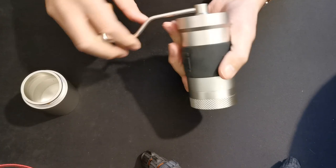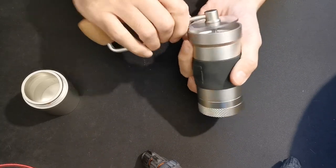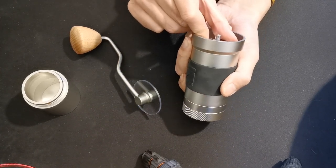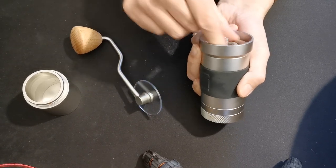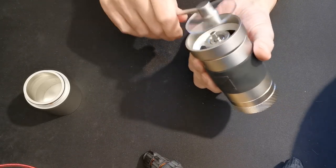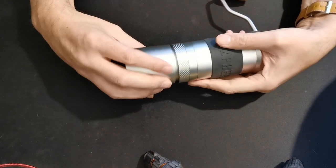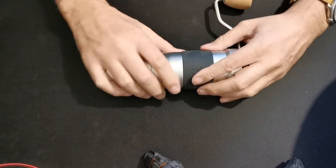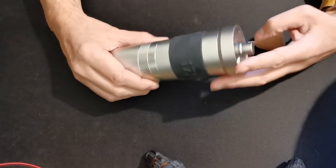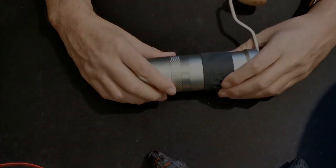Put the handle on for a quick check. Come back one or two turns — it's numbered, so if you can see the numbers it makes it easier. That's probably two turns back to the espresso setting. Put the handle on, turn the grinder, and check there are no funny noises and everything is together as it should be. Finally, place the catcher pod on. That's how you put it together — you won't find that information on the internet. Bookmark the video; if you need to take this grinder apart again, just come back and watch it.